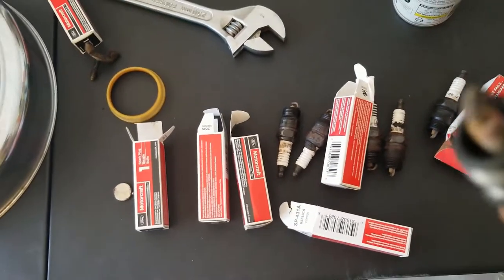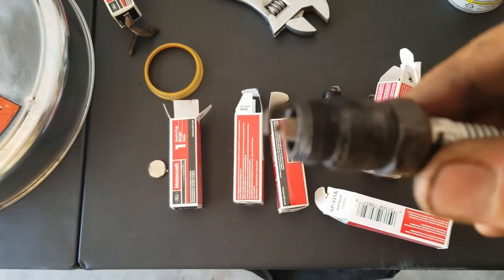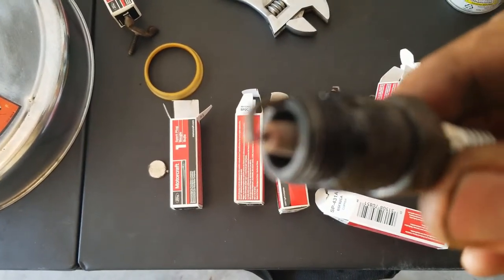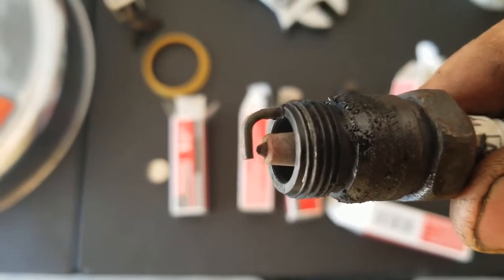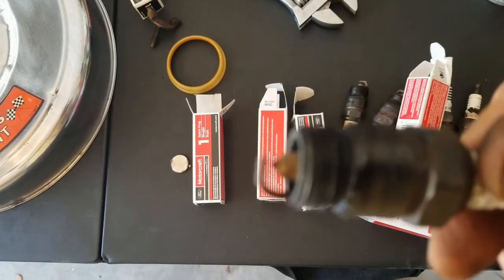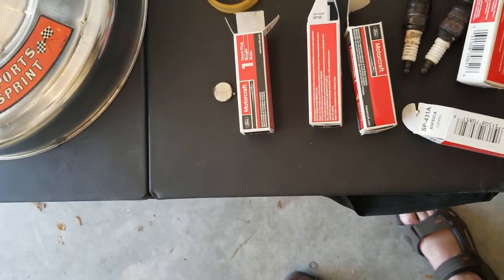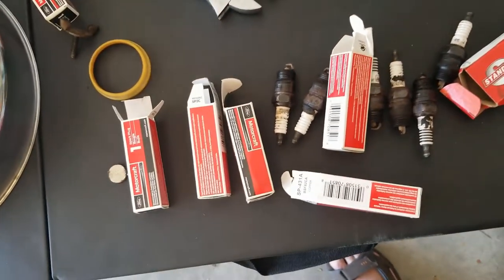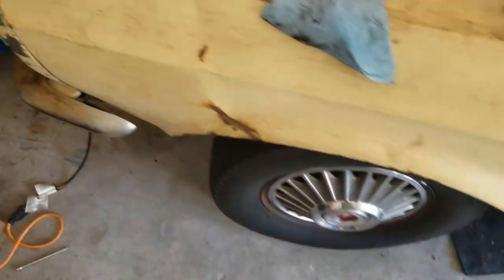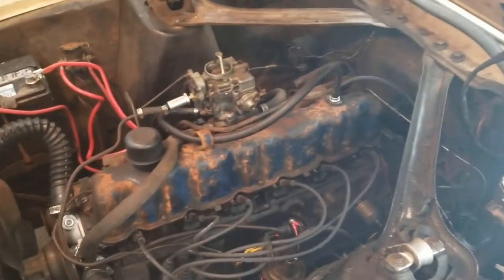And they actually weren't, let me get that to focus a little bit. Anyway, they weren't that bad. See, a little rounded at the end, but overall pretty clean. You know, for plugs that have been there for 22 years, no signs of a lot of fouling. Don't appear to be running super rich or anything, so they probably could have stayed in there. But since I rebuilt the carb, to get the most out of the carb rebuild, assuming it works,